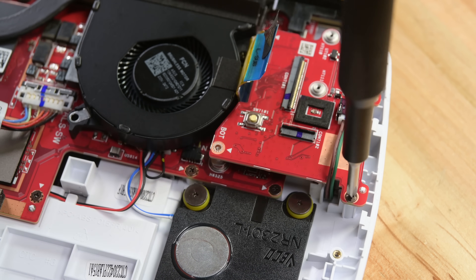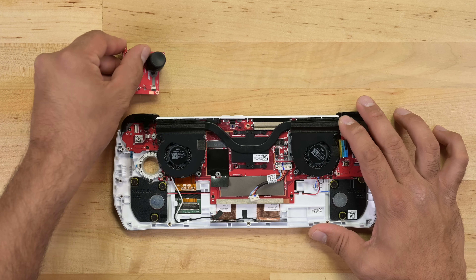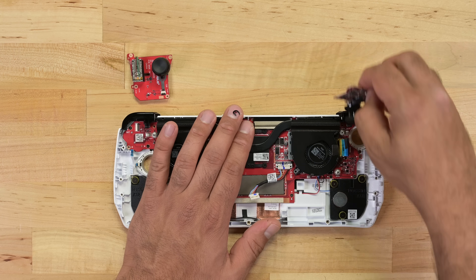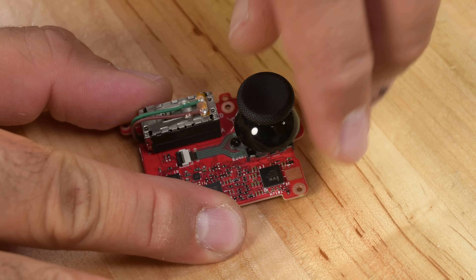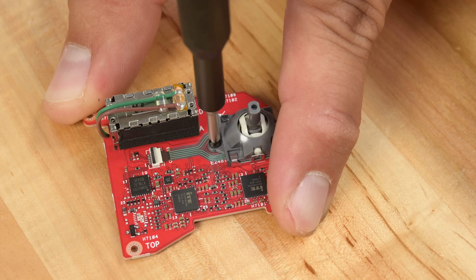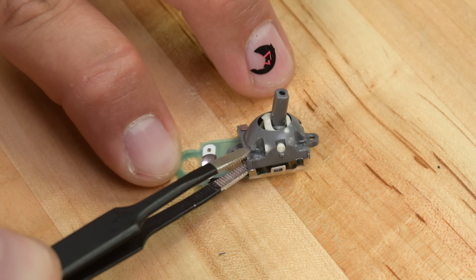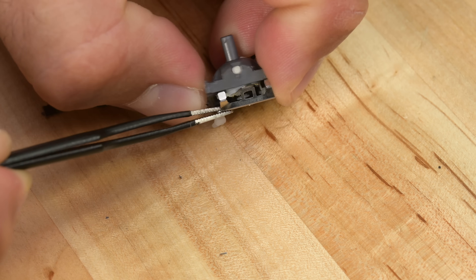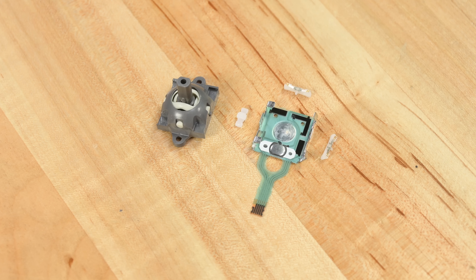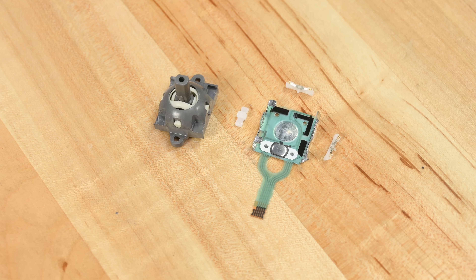The thumbstick board contains the thumbstick, rumble motors, and several ICs — a win for modularity. A drifting stick doesn't require replacement of the whole assembly. Unlike the Steam Deck's slightly more complex module with capacitive touch, two screws and a ribbon cable are all that hold the sticks down. While the thumbstick package may look identical to the Nintendo Switch, it is marginally smaller while being taller. The interior is unfortunately the same resistive film-based potentiometer stick that is prone to drift.